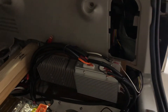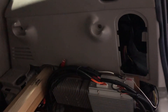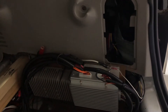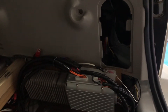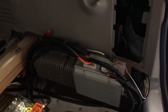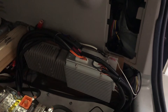Moving to the right, we've got two little boxes. The one in the front is a DC-DC converter — basically the electric car's alternator; it takes power from the big batteries and puts it into the little 12 volt system. The box to the right is a battery management system. Lithium batteries can be cantankerous — they can explode — so this management system monitors temperature, current flow, and voltage. It lets you calculate remaining battery percentage, balance the cells, and prolong battery life.